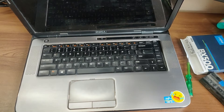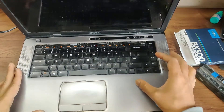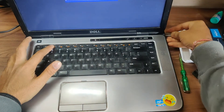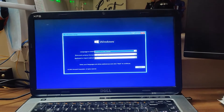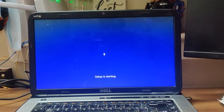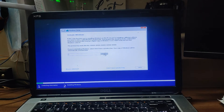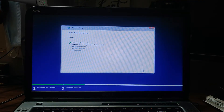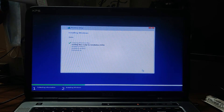Let me turn on the power. We'll press F2 to boot it. Now I'm installing Windows 10 — select it, next, install now. It's looking for the product key; let me quickly enter that. As you can see, installation has started. This is Windows 10 and I'm installing it on one of the partitions. I've created two partitions — one for other files and one dedicated to the operating system.